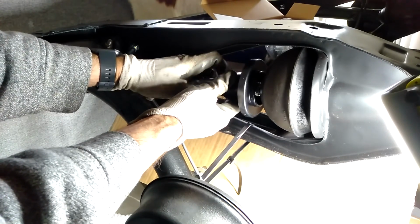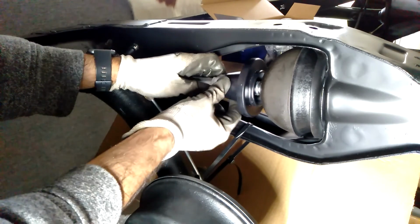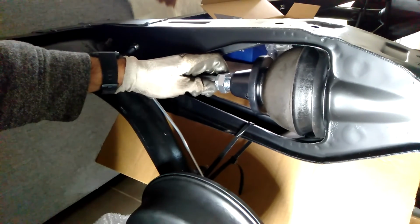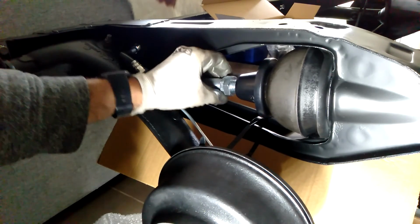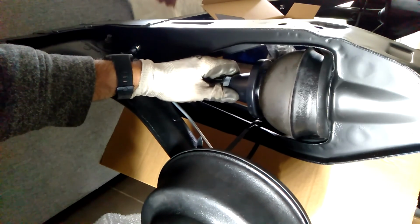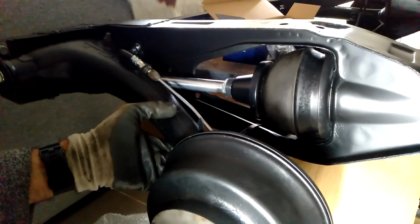And then all we do now is just move that nut or spin that, it doesn't matter which way. That will adjust it based on the normal height. So normally this arm would sort of be up there somewhere, and then you can see how that's compressed and staying together. But because this won't be fitted to the car for a while, I will loosen this down, because that way it will enable me to get this radius arm at least in that position, just so it doesn't get in the way when I'm storing this.